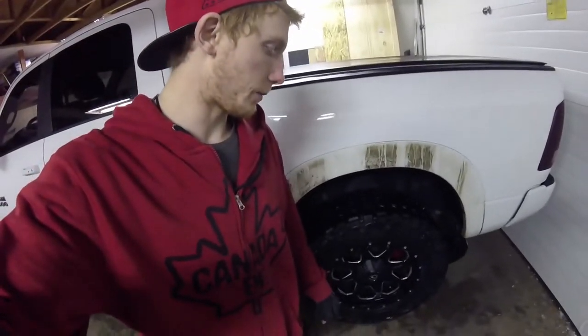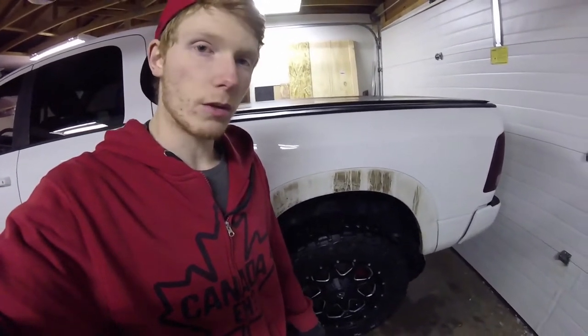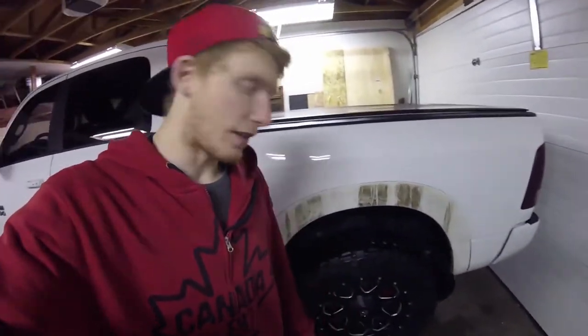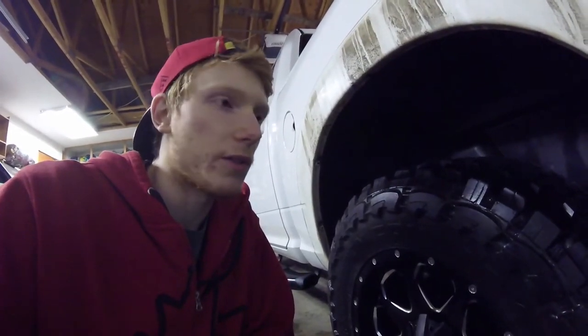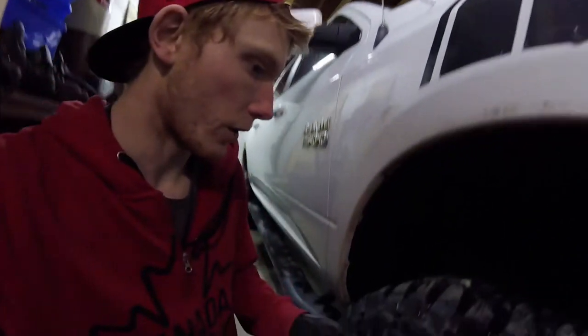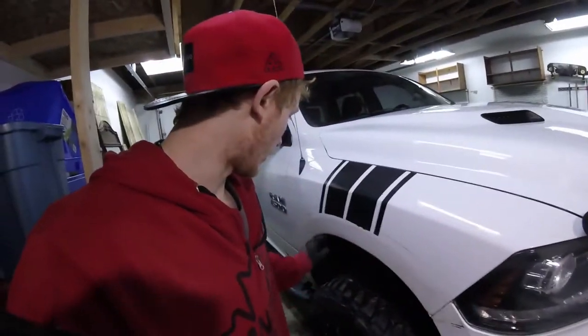So you can see how brutal that is. I mean, I didn't snap as many as I thought, but I did snap four total out of all of the wheel wells. And that's enough that I want to replace it anyway. This is why you should do this kind of stuff as soon as you get the truck. So let's see what I have to do for the first one that broke. I'm going to try to use some pliers and grab on and see if I can turn it, but I really doubt that's going to work. No, it's definitely not going. So I'm definitely going to have to pull out the grinder and grind that bolt off, and we'll see if that works.